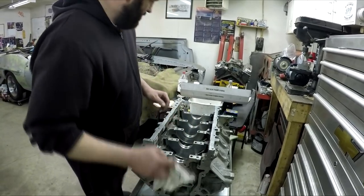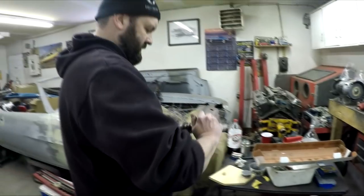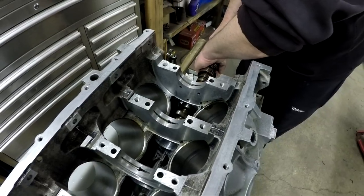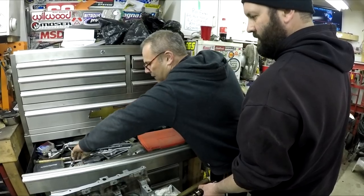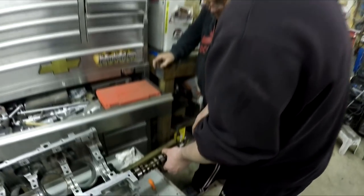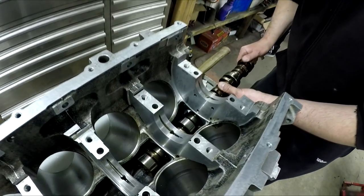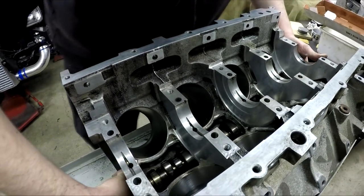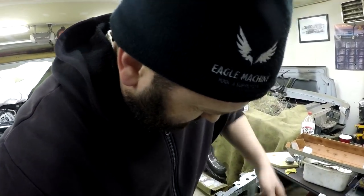Something's not right — the cam is not going through. It's not going in through the bearing. It's tighter on one of them. There's a burr right here — the edge got fucked up a little bit. When you were doing the last bang, you banged it in. Just feel right there — it's a burr. And that's why you test fit a cam in there when everything's torn apart, because if you assemble the engine, then you'd be in trouble.